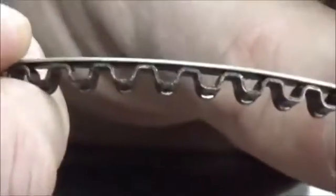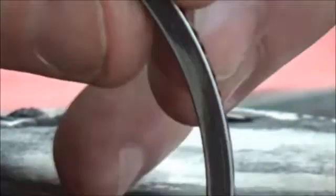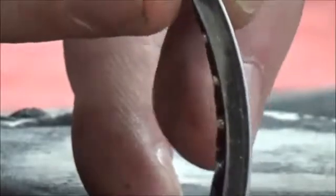If this rail is allowed to go on top of this, here I'll put it together wrong. If it's allowed to go on top, it's going to make the overall thickness much thicker, and it's going to wedge and lock into the piston. Let's see if we can get the back side of this. Here I'm on top of that back lip. Notice how the back side of the expander ring disappears because the rail is on top of it. This would be incorrect.